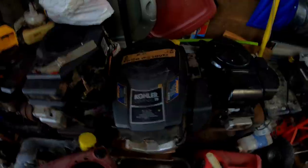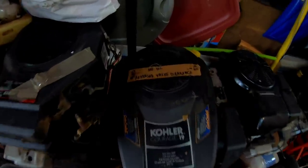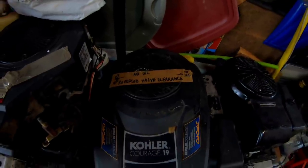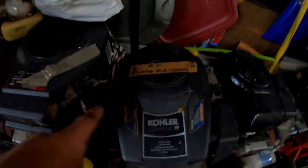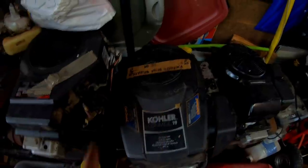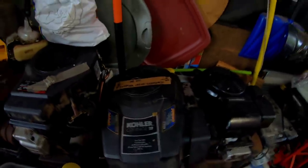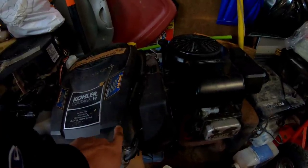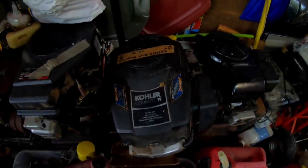This is the Kohler Courage that I rebuilt. I reversed the valve clearances, so if I ever plan on using this, I need to put the valve clearances at 7 and 5 instead of 5 and 7. And I've got to put oil in it. Also, the spacer between the carburetor and the engine block is wrong. So one of my subscribers sent me a spacer. So when I get a chance, I'll do that too.